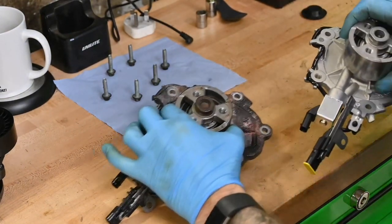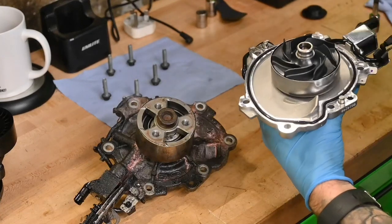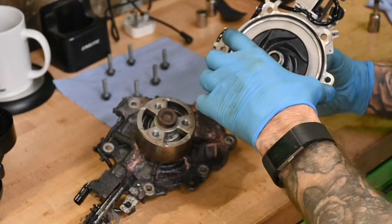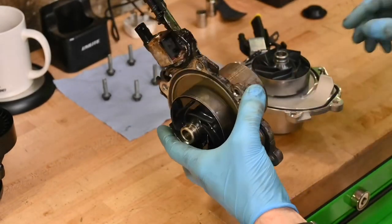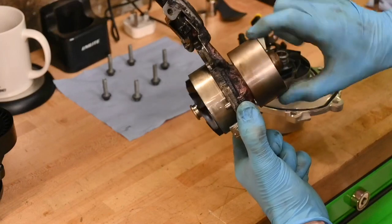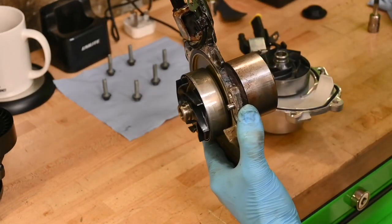Now we can compare the old pump with the new one. This is a genuine one from Jaguar Land Rover — it comes with new sensors and as a complete unit with a seal pre-manufactured in there, so it literally is just a case of bolting it up to the engine. It's also got a couple of dowels which help locate it in place and fail-safe so you won't put it in the wrong position. What I suspect happened is the dynamic seal inside the housing failed — as the belt drives the impeller, it just leaks out through there and gets thrown everywhere by the spinning.